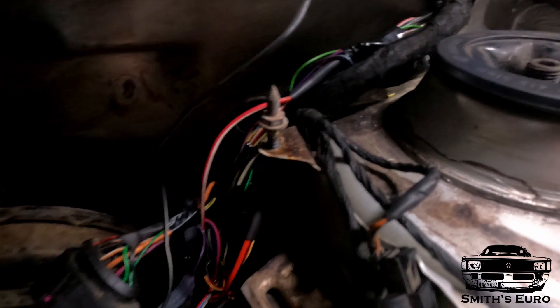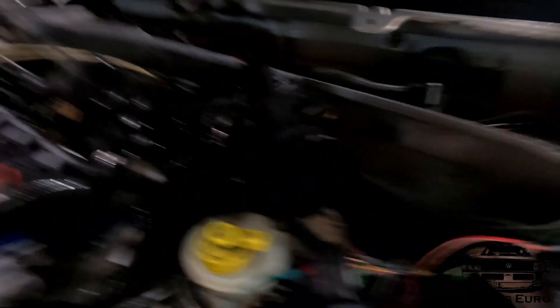Here's a good way to test for that. Right in here, this is the Mark 4 harness but it goes directly into the Mark 3 harness, which is like your G1, G2 connectors in the back of the CE2 fuse box. Right here - G105, ground on cylinder head. Brown and white wire, G105. Remember that - G105, this brown and white wire in the Mark 4 harness is the exact same but it's now pin 9. I double checked, triple checked - it is just a single direct wire directly to the fuse box.